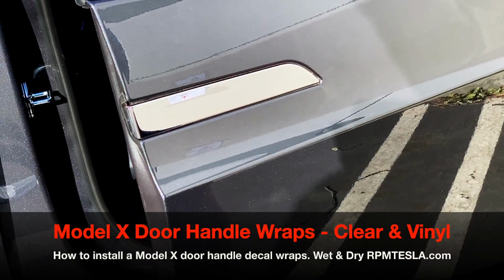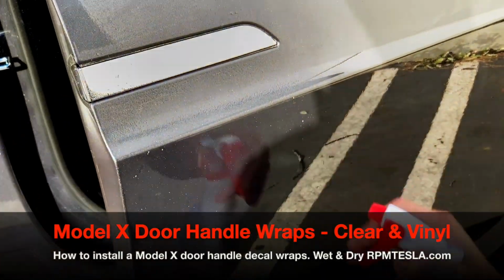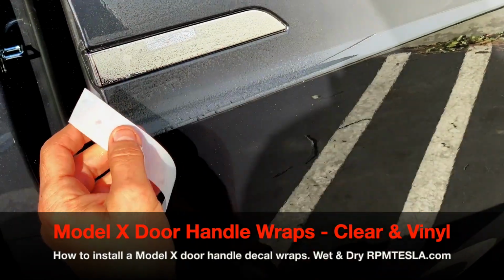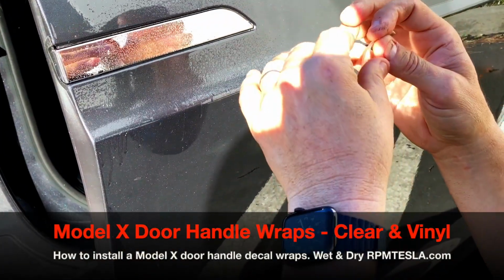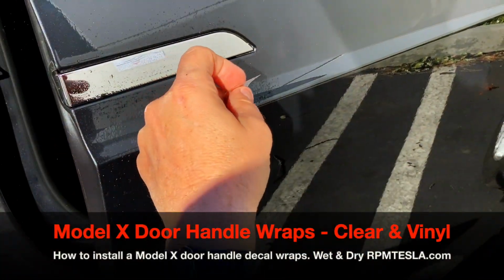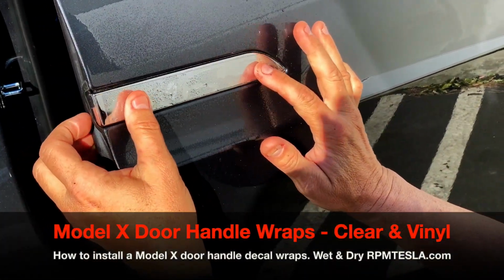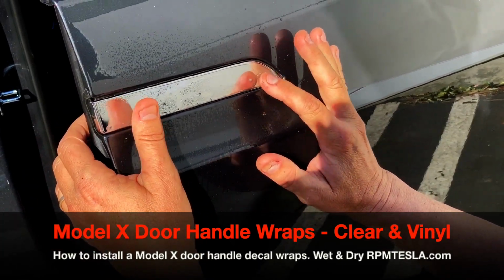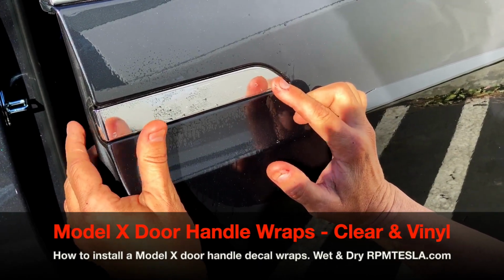So with the soap solution, first put it on your nice clean fingers, put it on the car, and with your fingers nice and wet, to avoid making fingerprints, just peel it off. And once you peel it off, the first thing you're going to do is spray the back of it and the front. So basically everything is wet, and this gives us a lot of time to locate the ideal place. So see how this moves around?